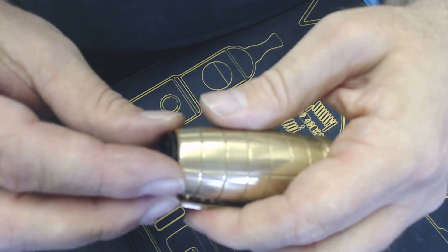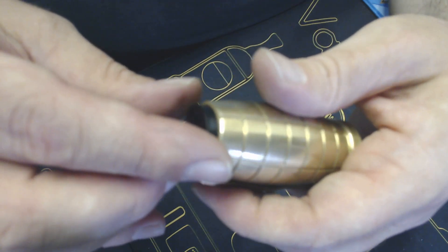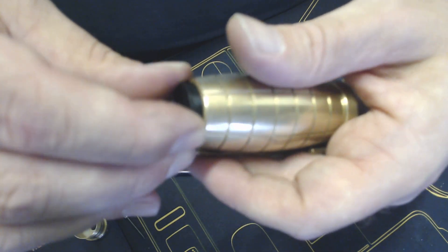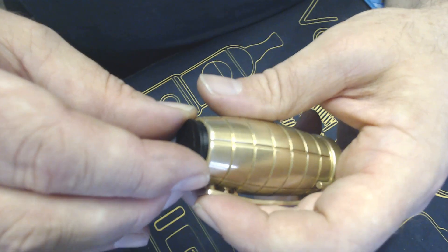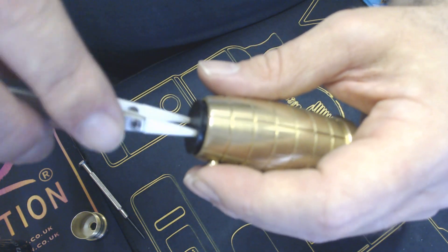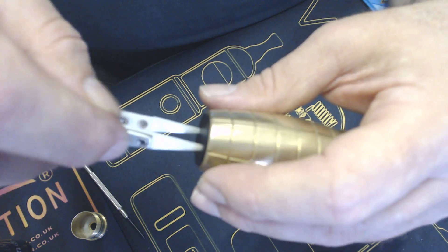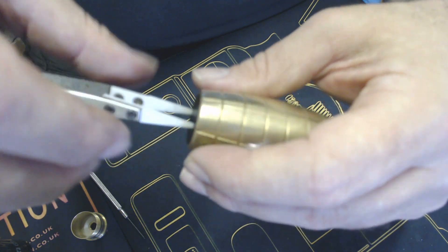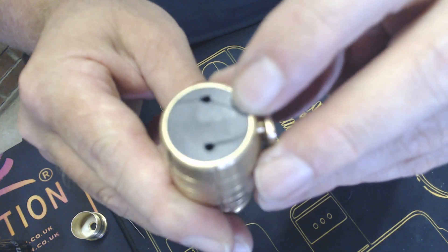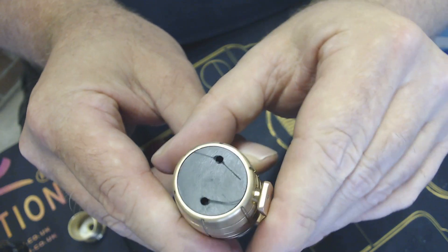Let's pop that bottom contact back in. It is plastic threading — just be really, really super careful that you don't cross-thread it. Let me get my pronged tool. There we go. Don't overly tighten the bottom either — just do it so it nips up. That's my advice, because they will skip out and you will scratch that bottom.